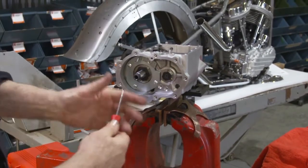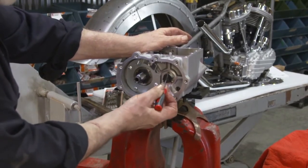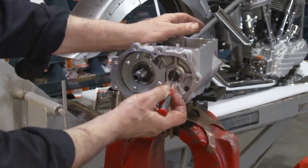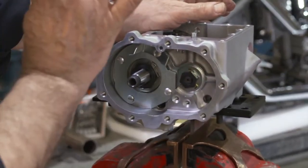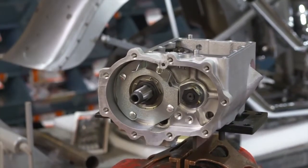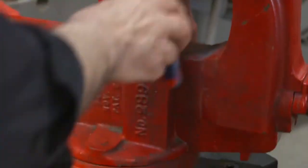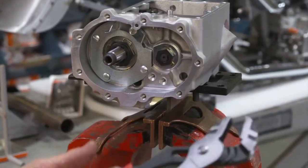And now, again, as I mentioned to you earlier on the main shaft, we will tighten this until one of the flats of the nut lines up with a respective tang, one tang only. You don't lock all three, you lock one tang. And then once we're tight, we adjust our channel lock so that with one shot, we're able to pinch that down nice and clean without a lot of claw marks, and we're done.